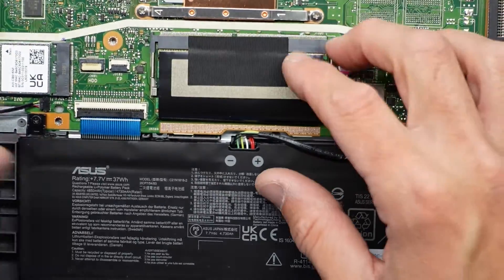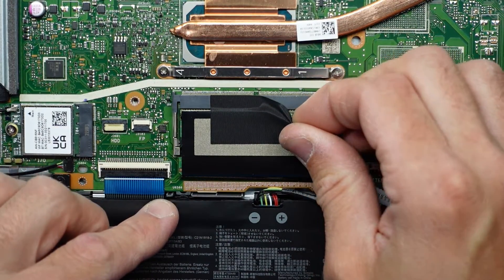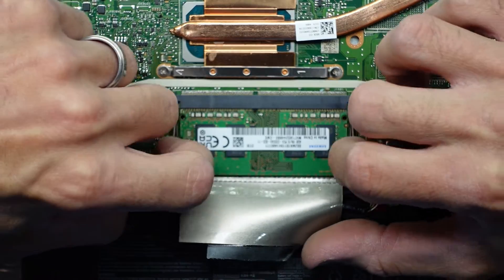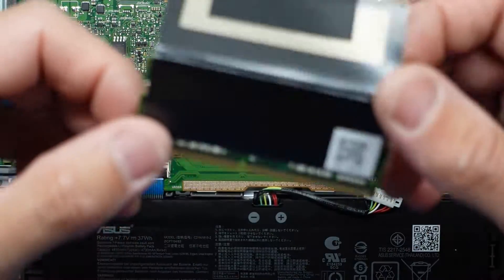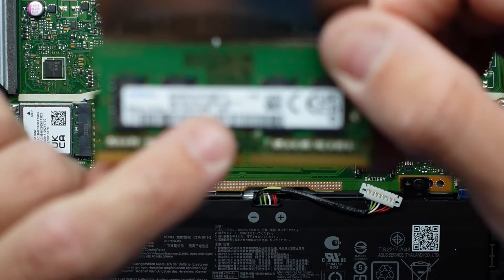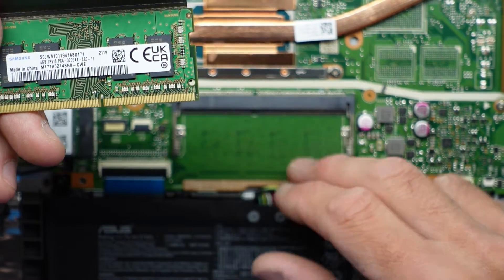Battery disconnected, I want to have a look at the RAM. There's tape holding it down, so I pull the tape off to reveal the RAM. Two tabs pull out and the RAM sits up. It's a little RAM cover on here. This machine showed 8 gig of RAM when I fired it up, but I'm finding it contains a 4 gig stick of PC4-3200 — and there's 4 gig of onboard memory, probably on the other side of the PCB.